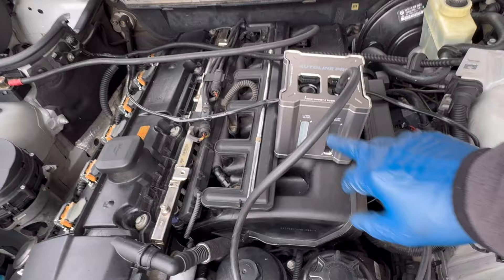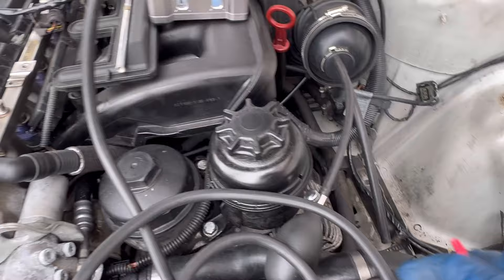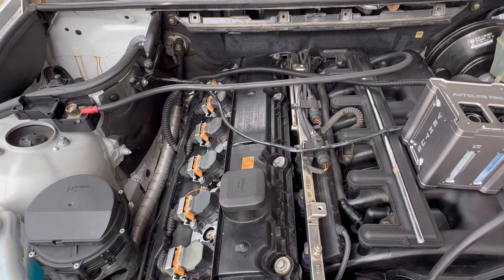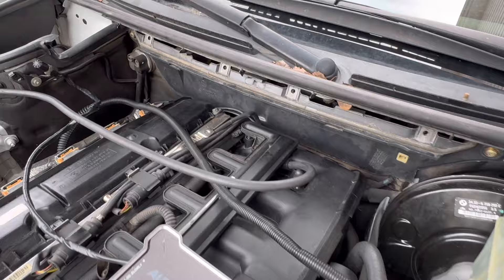Hopefully that also takes care of our no-heat situation — we were very low on coolant, so that makes a lot of sense. To check our work, we're going to smoke test the system. We've got our AutoLine Pro Aventus system — it's very simple, holds your fluid, just connect the hose down to the intake adapter. Quick hit of the button, you see it light up blowing bubbles, and we already got smoke. We're going to wait and hopefully not see any smoke coming out of the system. We'll smoke long enough that once I remove the oil cap, we start seeing smoke come out of there — that tells us the whole system has been filled with smoke. All new CCV, valve cover gasket, new silicone lines, upper and lower throttle body boots, throttle body gasket, intake gasket, and the suction pump for the brake booster — those are all common leak points. So far I'm not seeing anything, which is good — but we always want to check our work.